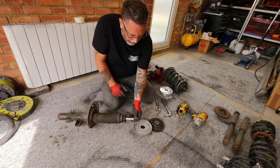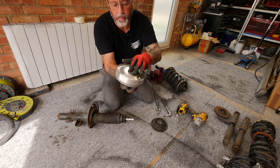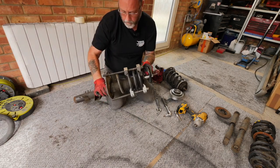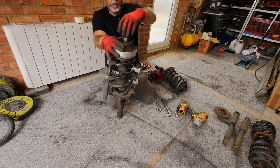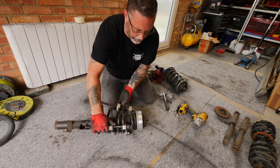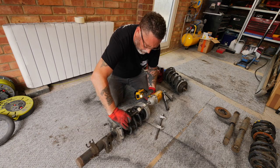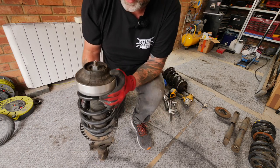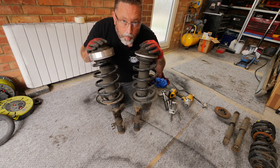We've added 25mm to the top of that. The chamfered bit goes on top, the spring sits on top of that, the rubber sits on top, then we bolt it all back together. Drop it back in, top nut back on, tighten that up until it's tight. Get the spring compressors back off and that's done. There's one done — in theory it's 25mm higher. I'll stand it up against the stock one so you can see the difference. I'll get the other one done and then we'll go further.